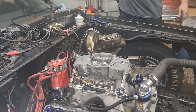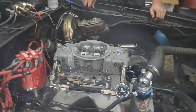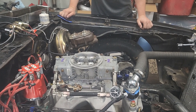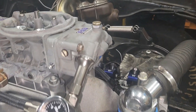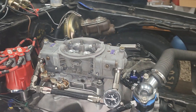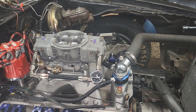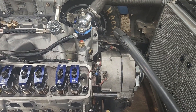I'm hoping it starts up and runs on the E85. It's supposed to be an E85 carburetor and it looks like it is, but it was also supposed to come off a running car. There's no way it was that clogged — or maybe it sat with E85 in it. It was dirty, and one of the bolts for the fuel bowl was stripped out so we tapped it to a quarter-inch 20 and put a different bolt in it. Hopefully it works. We're going to set the rockers, put the valve covers on, put the forward-facing headers on, and then see if it'll start.